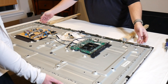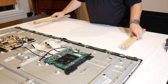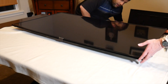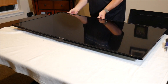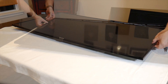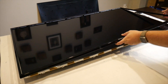We now need to flip the TV onto its back so we can work on removing the bezel. The way that works best is to take a few pieces of 2x4 or 2x2 boards and position them beside where the TV power and logic boards are. When you flip the TV over, carefully rest the metal backing of the TV on these boards to protect the electronics by elevating it off of the ground. Now we can remove the bezel, beginning at one corner, slowly lifting up and detaching it from any connecting clips. Carefully work your way around the bezel until you free it entirely, then set it aside.